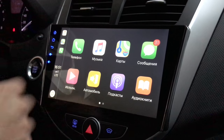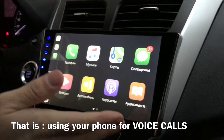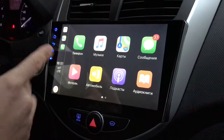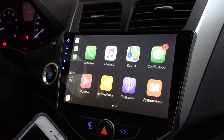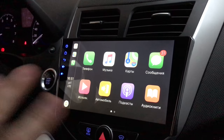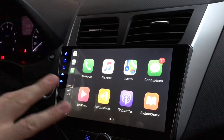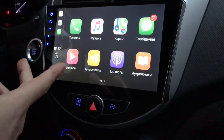The other thing that was kind of annoying but is easy to fix is using your telephone. By default you'll probably have your phone paired to your head unit via Bluetooth, and if you're not using CarPlay it just uses that Bluetooth connection so you can take phone calls easily. But if you have CarPlay plugged in and want to use the telephone function, it will not use the USB connection — it defaults to Bluetooth. You can leave it like that and it sounds more or less fine, or you can go on your phone and turn off Bluetooth when using CarPlay so calls go only through CarPlay with better audio quality.